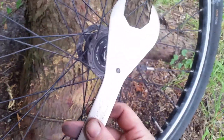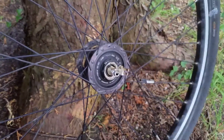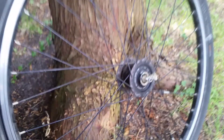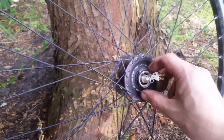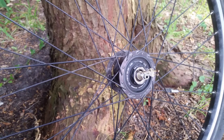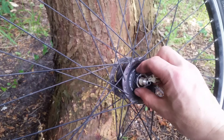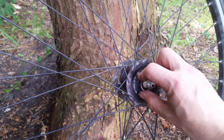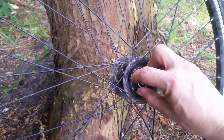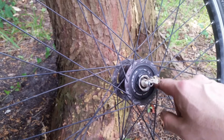I tried to open it up on the other side further but couldn't. I tried a 32 millimeter headset wrench and it fits, but you can't apply enough force. There is a special tool for it — the TL DH 10, 32 and 36 millimeters — this needs 32. It's 8-sided and not 6-sided, so you can't use a standard 32 millimeter box wrench — 'Ringmaulschlüssel' in German.